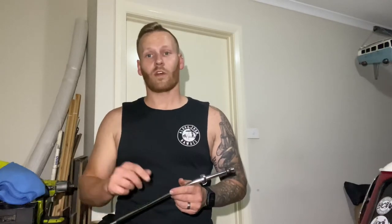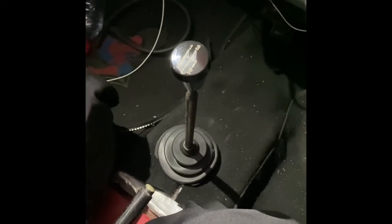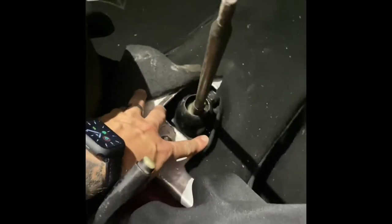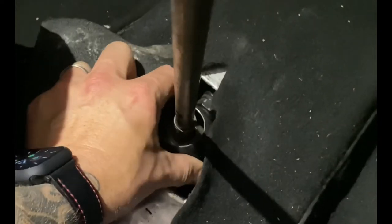That's exactly what we're going to do. Let's go to the car and install it. On the Mini there are two types of gear selectors: a rod change and a remote change. Mine has the rod change, so we're going to remove the gear stick now. All we need to do is unscrew the gear knob, then remove the boot as it comes off — this will be the same for most cars. There's a collar at the bottom which we turn to release, and then the old gear shifter pulls straight out.